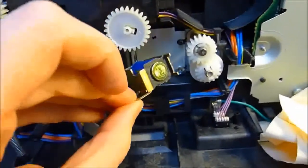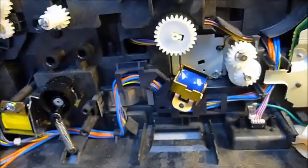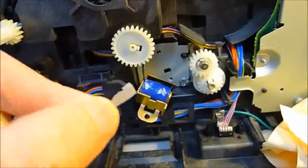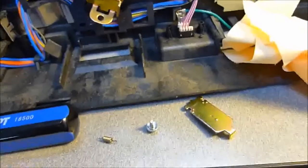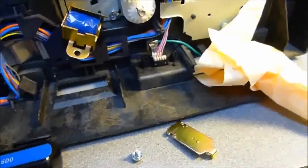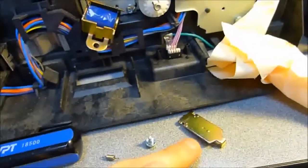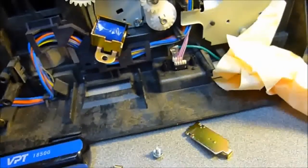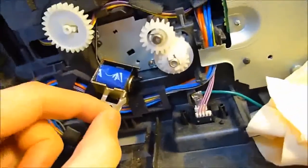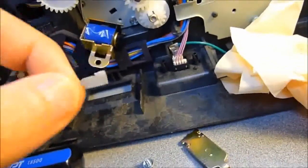While I was doing this I looked online, and it seems that contrary to what I said previously, what we actually want to do is take some kind of piece of plastic or some sort of non-magnetic material and stick it back in the place where the adhesive used to be. The reason is that a lot of times people just clean it off and don't replace it, and then there's a problem with residual magnetism from the solenoid — it fires, causes the metal to still be slightly magnetic, and then you have the same jamming and timing issues, because all it takes is a microsecond of delay for the printer to jam. So I'm going to stick a little piece of tape back on there.